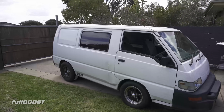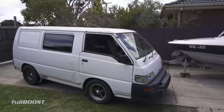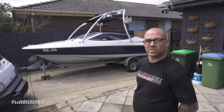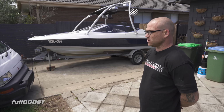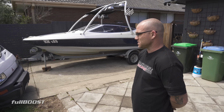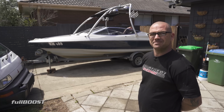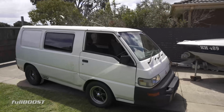So what gearbox is in it at the moment? It's got a 4L60. And it's been alright? I did just have the gearbox built, so it's got all the 4L65, all the good stuff. I know everybody said, don't do it. Luke at Hastie's Automatics built it, saying he'd guarantee it to 450 kilowatts. They do cost a little bit to do, and maybe a hand grenade. It's been grouse.